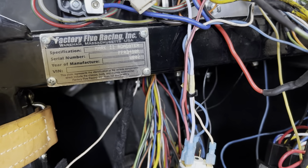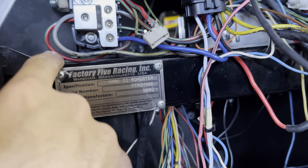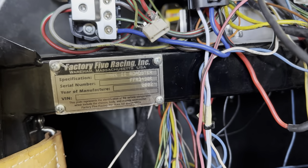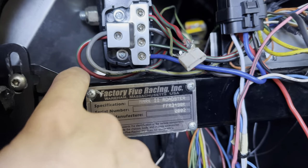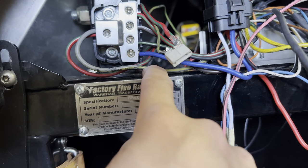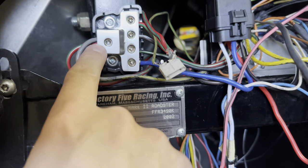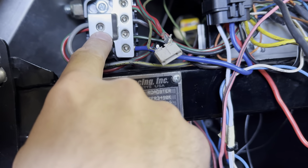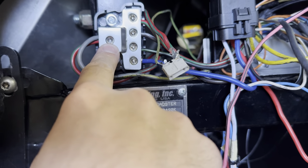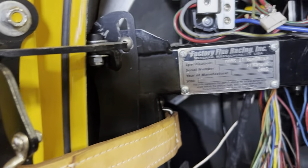While I was in the area doing a little more wiring cleanup, I had a second gray with yellow wire coming out of here that was no longer being used — it was just taped off — so I went ahead and removed it. I think that went into one of the wiring harness connections I removed when I gutted the harness. This red with green that's now going into that spot was actually a loose one that was snipped from something else in the harness. Instead of cutting it out of the harness, I tied it into this spot in case in the future I need a 12-volt switched heavy duty lead. I reloc-tited the set screw, put it back into place, checked continuity, and everything is good.